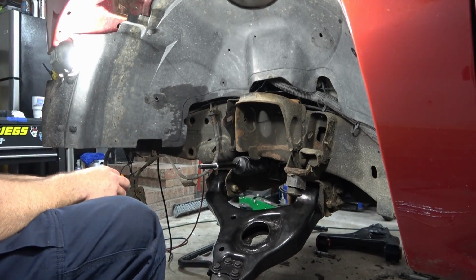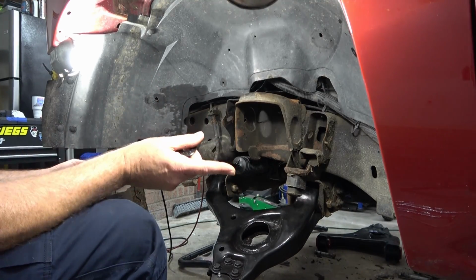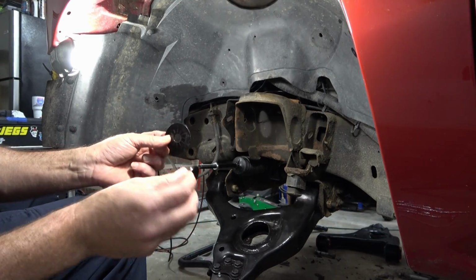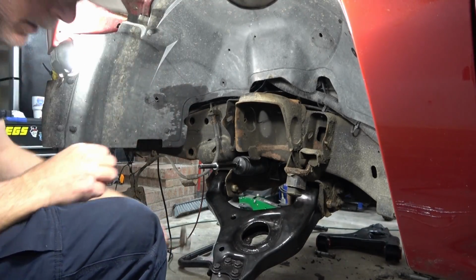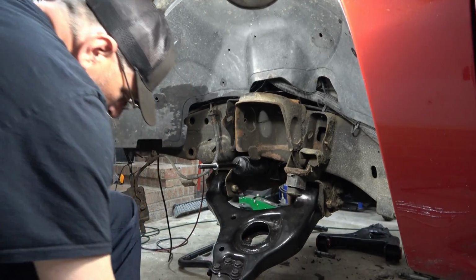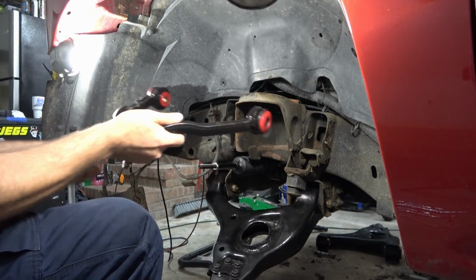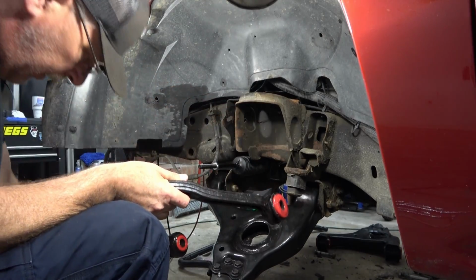With your upper control arm, if you saw my earlier videos, and I'll post a link to the videos at the end of this, we cut the old washers off of the old upper control arms. We're going to reuse those, same thing with the nuts and bolts. With these aftermarket polyurethane bushings, we've already greased them all. They're ready to go, but you do have to have your washers in between the bushing and the mount area.